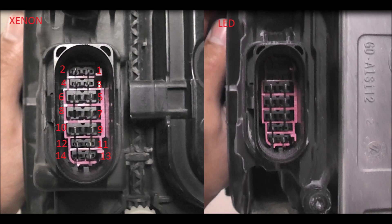Basically all I did was add some wires and repurpose one wire. You'll have to do this for both sides of the car. The only wire I actually added was pin 8, because that was not there at all. I couldn't reuse any of the other wires because this is a high-current cable that was needed. As you can see, the pin is a lot bigger than the ones on either side of those six pins. So I had to buy a wire and rewire this, and I had to do this for both sides.